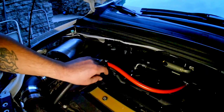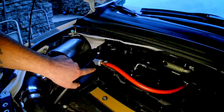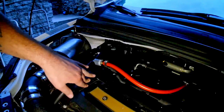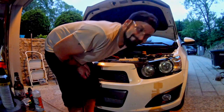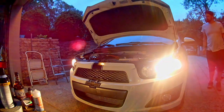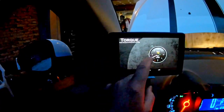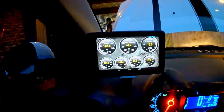I got it all fixed up again — all the hoses are run, I got the new vacuum line, it's just zip tied to this bigger hose here so it keeps it off of the alternator, because that down there gets really hot and I don't want to melt it. Let's start the car and scan for codes now. No fault codes stored, so I guess we're okay.